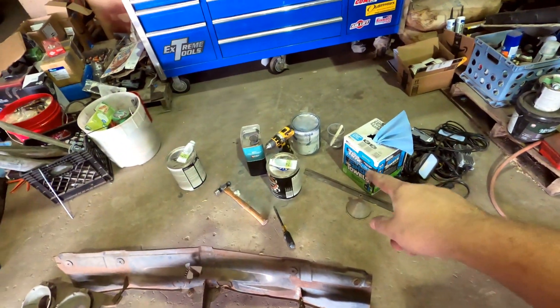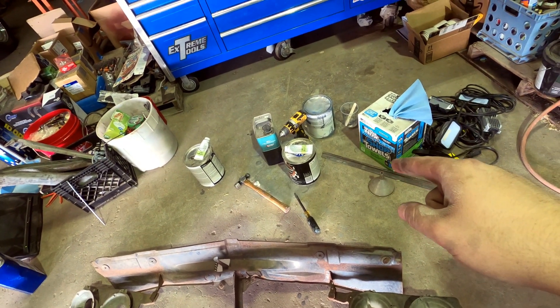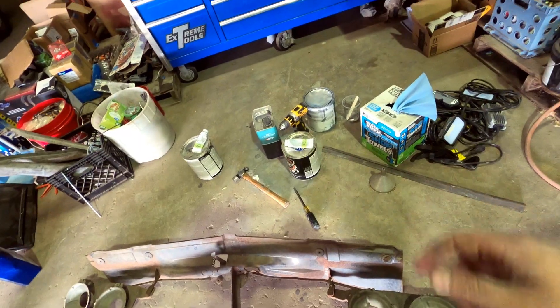It's not show quality — I don't want it to be show quality. I want to drive this car, but I don't want it looking like a complete hack job. My thing with the filler is I'm having to do like eight coats to one area just because I can't work it the way I want to. It's got some low spots I can't seem to build up. I do sand down to the extent of the whole thing until I've got metal showing through, so I know I'm wasting a ton of filler. We are going to mix up some one-to-one gray primer paint and epoxy that, because it got a light rust coating for the week or two I left it. Let's mix some of that up and get it sprayed on — we're going to bring you guys along for a fast forward on the mixing and the painting.